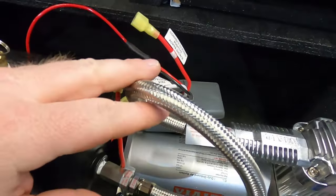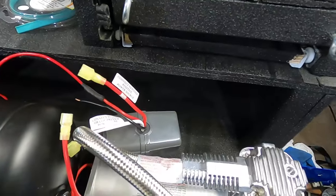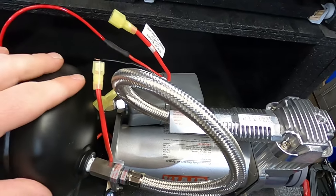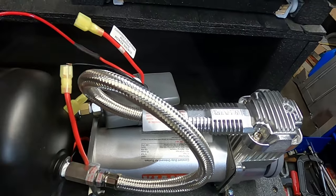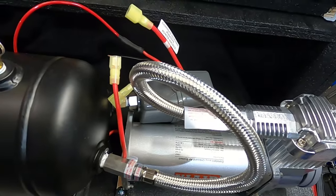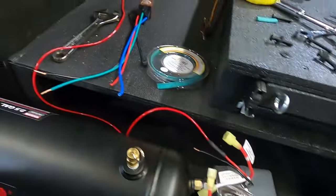When the compressor turns off, the countdown timer is set for 3 minutes. That means the fan will run for 3 minutes after the compressor shuts off, and then it'll turn off. Now, if I'm using this thing a lot, in that 3 minute time, the fan could be running, the compressor could be off, but then I could start using it again. Compressor kicks on, the fan will just keep going. So once there's no power for 3 minutes, then the fan will shut off.